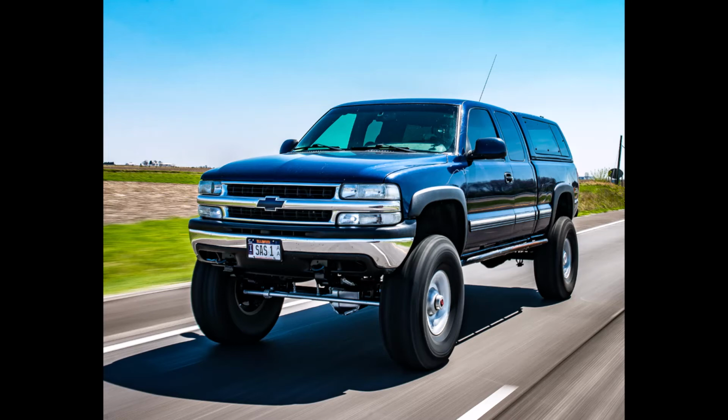I was like, yeah, this will be just like stock. And I redid the math on it. What it comes out to is the final ratio right now would be the same as having a stock Jeep with 373s instead of the 355s it came with. Yep. So I'm slightly under. Yeah, that's nice. I don't think you need to be way under.